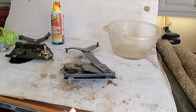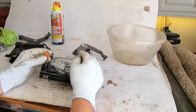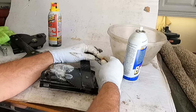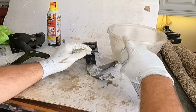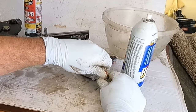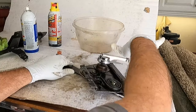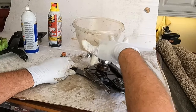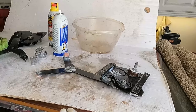I'm also going to clean out all the tracks on the inside and spray those with white lithium grease too. I also have new bushings — I'll clean these studs off first and then put those bushings on. That little clip locks it on so it's not going to come off. Flip it over — this stuff gets really messy but we just want it to be smooth. Those go on easily — they just pop right on. Running it a few cycles — look at how smooth that is now. Piece of cake, this is going to work great.